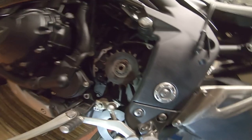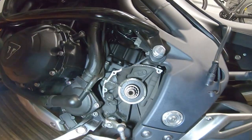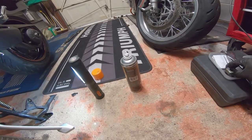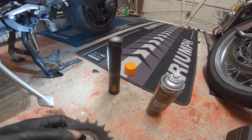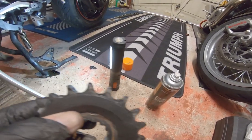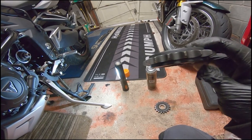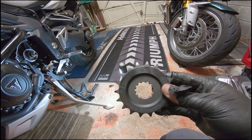Now this should come off — there we go. We'll be able to clean up all around and behind here, get all that crud out. Give the nut a quick bit of TLC, just cutting most of the surface rust off. This is the old sprocket, this is the new sprocket — you can see that one is definitely shark-finned and worn. When I install these I always install them with the writing facing outwards, just in case there's a difference — that's usually how the manufacturer wants it.